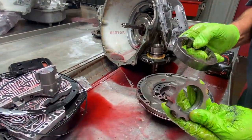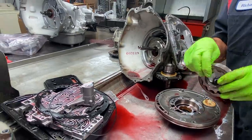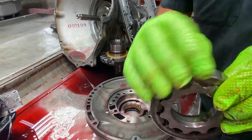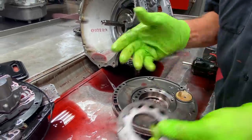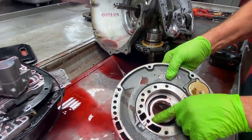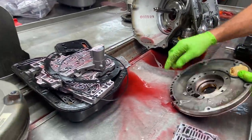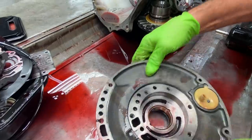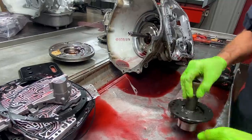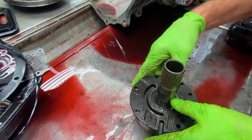Look at your pump gears really close. You don't see much pump wear on these type of pumps. We'll see it more right in here and here where the converter locks in. We really don't see body wear, side-to-side wear, or anything like that. Chrysler has a really good pump. So look for anywhere here, anywhere through here. Beautiful pump body. Got our dimpled bushing in there, keeps it bushing really well and oiled. Same way here, looks really nice.